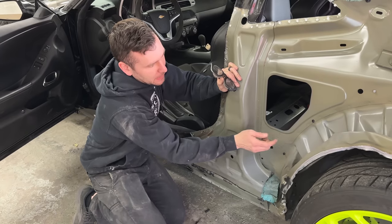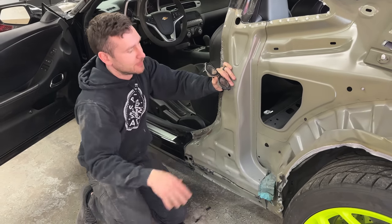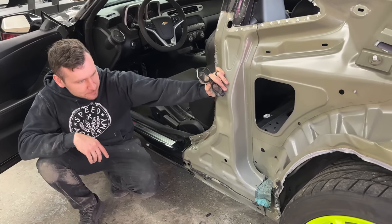This is going to be the biggest thing right here — pulling this pushed-up wheelhouse. Worst case scenario, if we have to get into replacing that we'll just be looking at a lot more time and labor, but obviously it can be done if need be. It's its own panel, but it also sits behind this, so we have a little bit of a wait for the new quarter panel from GM since we didn't really plan on using a new one. But that's going to give us time to get this thing on the frame machine and figure out if that inner wheelhouse is going to be an issue, and if it is we can get one ordered up.